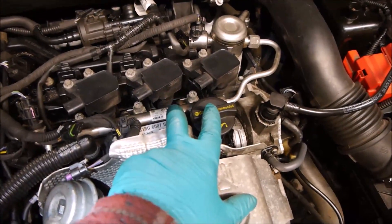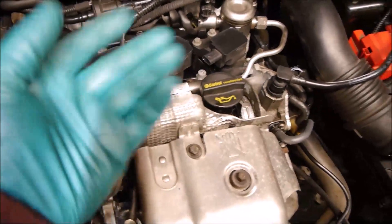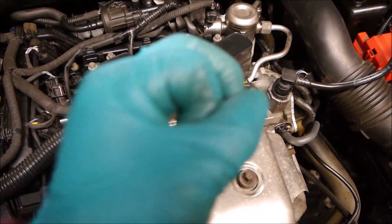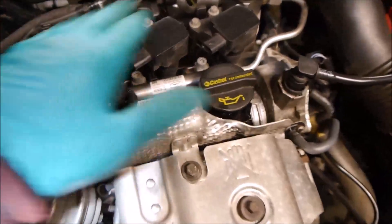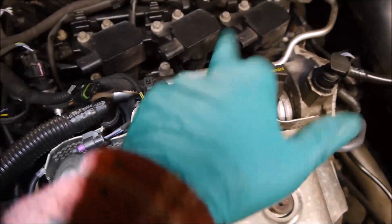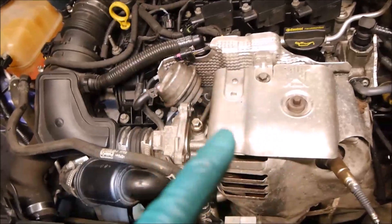Injectors are now back in. What I did find is as I pushed them in - I did a test, pushed them in, took them down, took them out again - those washers had squashed up nicely like the original washers, so I'm happy with that. Got the coil packs in. You'll note the wires are out of the coil packs, because it's a new engine - it's got oil in, it's got coolant in, but we haven't got the oil pumped around yet.